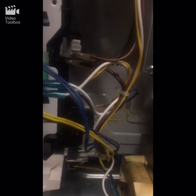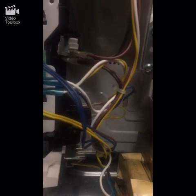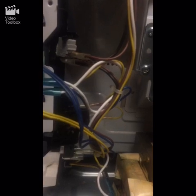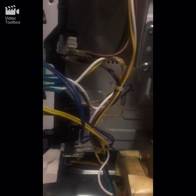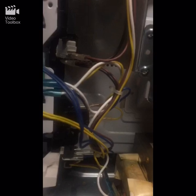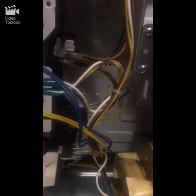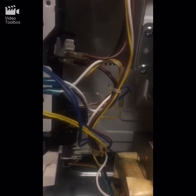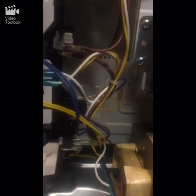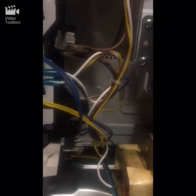I'm going to take it off and replace it. It's hard for me to pull this out while holding the camera, so when I put it back together I'll show you exactly what I did when I put the new switch in. Every microwave is different, but you should have three switches in there, and normally the main switch is more than likely at the top.